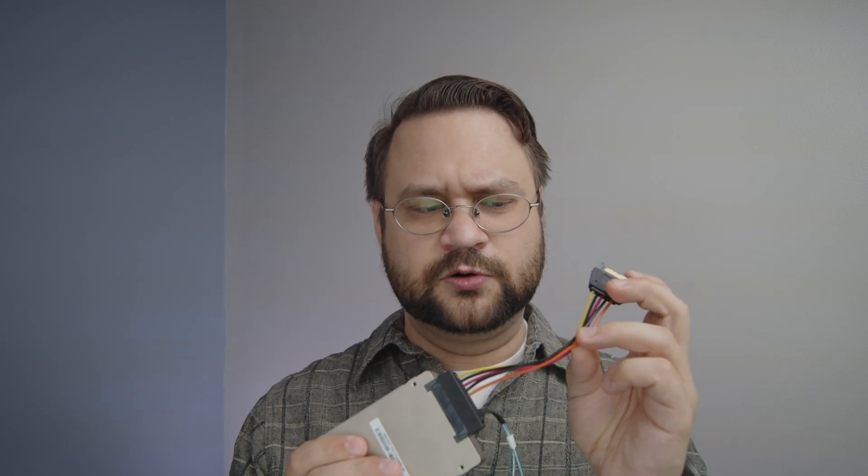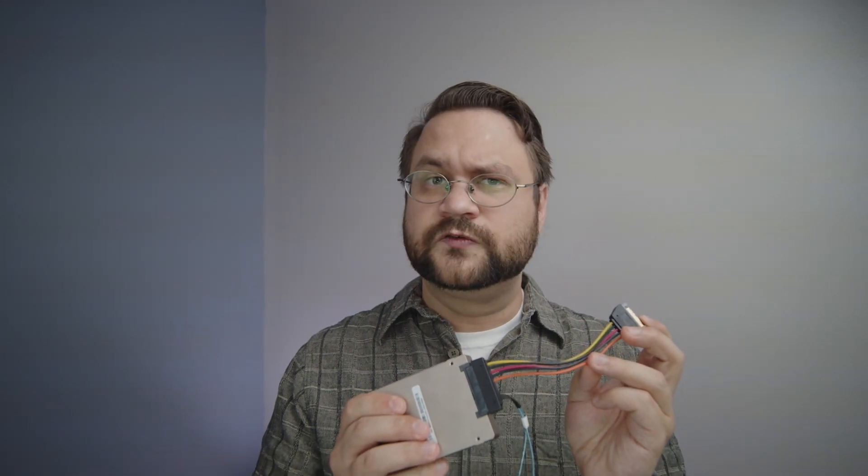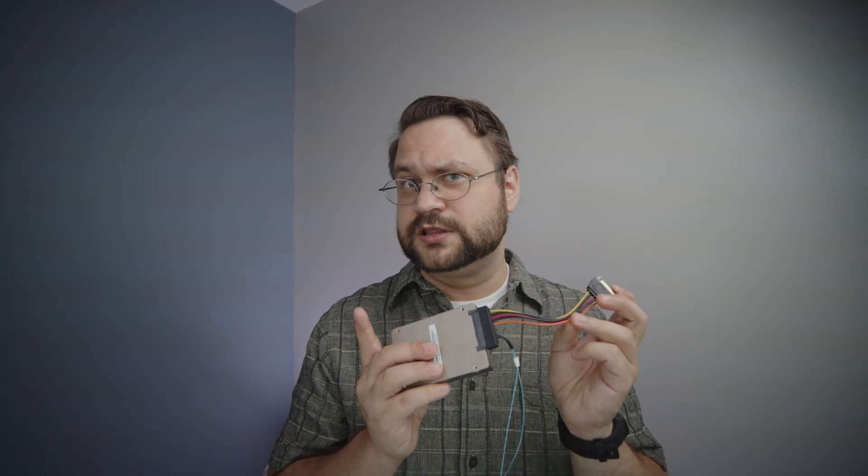Then I tried out one of these, which is SATA to SATA with five wires including an orange one, and this drive would not show up. Interestingly enough, my SAS 2 drives would show up, but not this SAS 3 drive because it's newer.